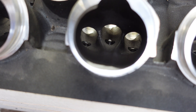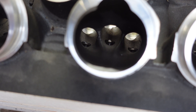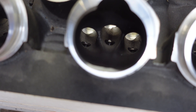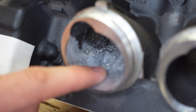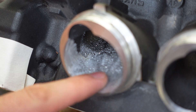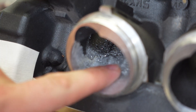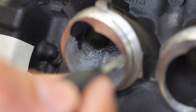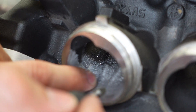Like I said guys, this is not for power - this is for better flow, and with better flow will come power. Not hogging this thing out. We're not looking to push stupid boost on this build. For mine it might be a little different. So pretty much the hard transition that they have going in here from the factory chamfer - I've pretty much removed that and actually have a better gradual path to the ports which will help flow and velocity. But like I said, we're not looking for a high horsepower gain, just better transition of the air.